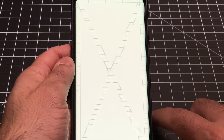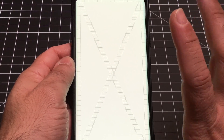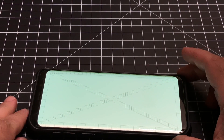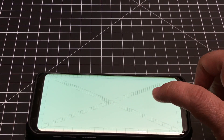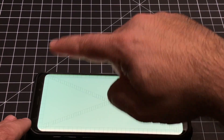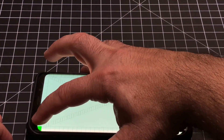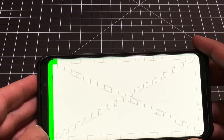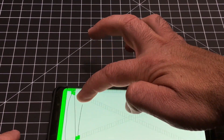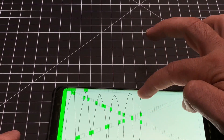This touch sensitivity test you may have seen me use in other videos when looking at screen protectors. Basically the test will be over once you draw the X, but since we want to test the entire screen and make sure there isn't any area with a faulty touch zone, we're not going to draw the X yet. So I'm going to run my finger up, down, and sideways just to see if there are any touch issues. You'll notice two things happen: I get a line, and I also get a green bar. I'm going back and forth, and what I'm looking for is the black line to skip.